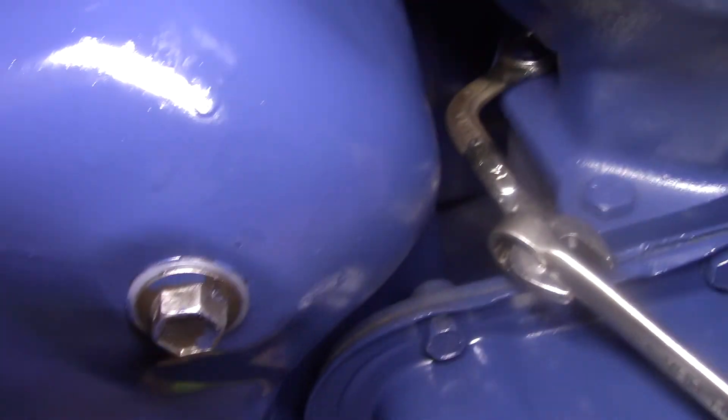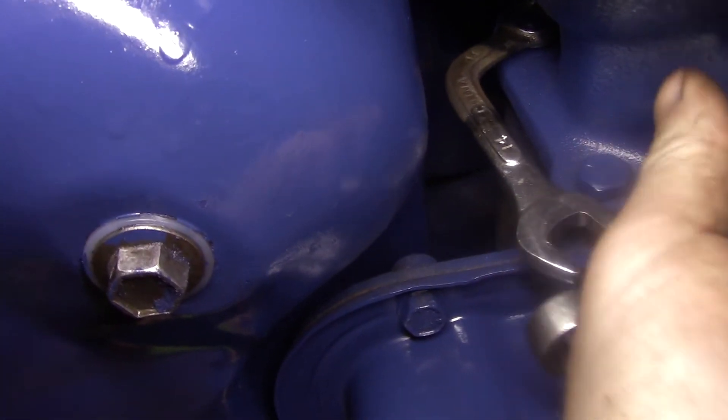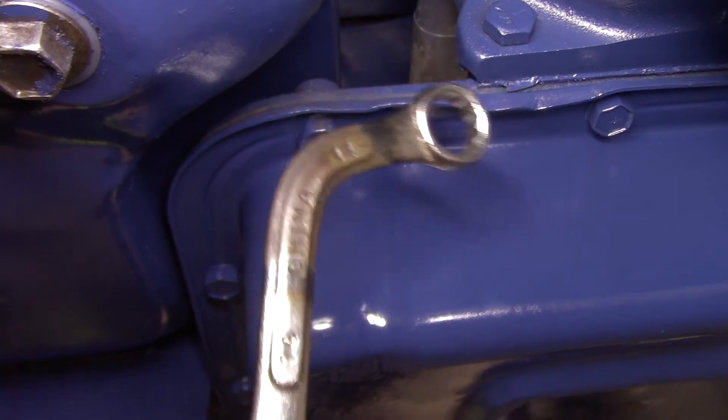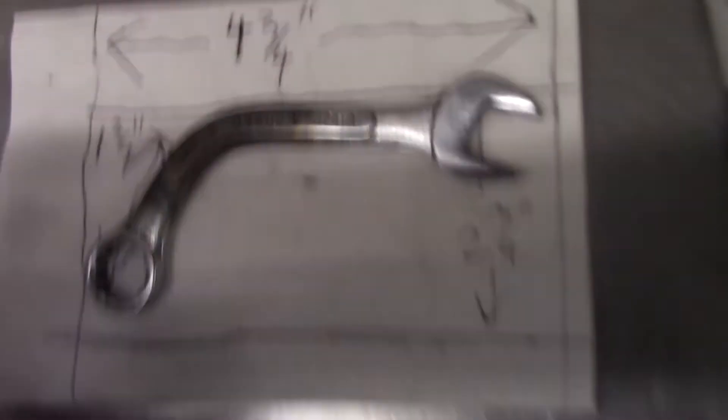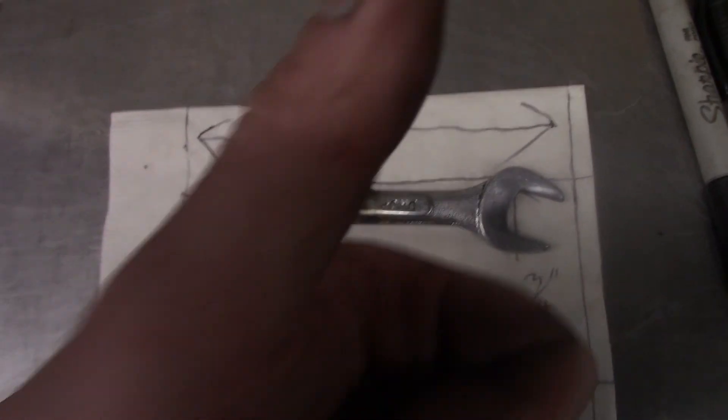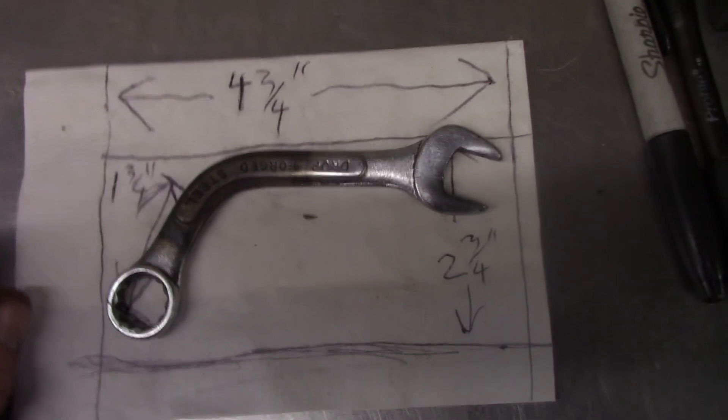It's been perfect. This is a 14mm, which is a little snugger than nine-sixteenths, which is what those fasteners are. So do yourself a favor — if you're going to tackle one of these, unless you've got an old-school fender wrench or door hinge wrench, get a cheap wrench and bend it. It'll make things so much easier. That's all I do — it works perfect every time. No struggle. You're welcome.